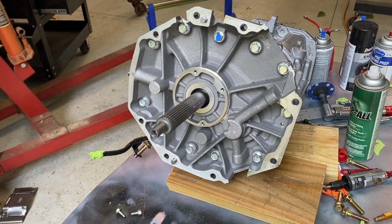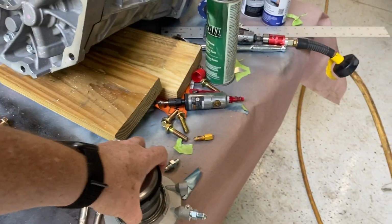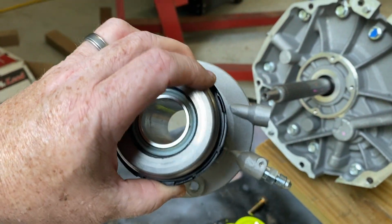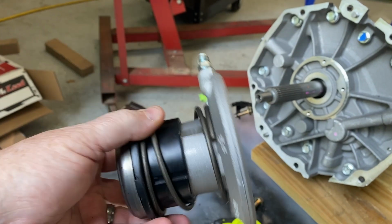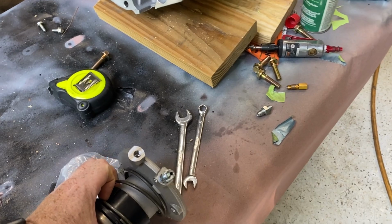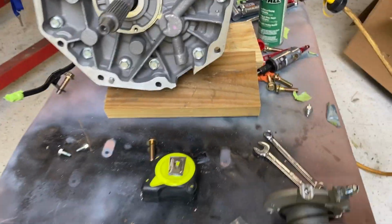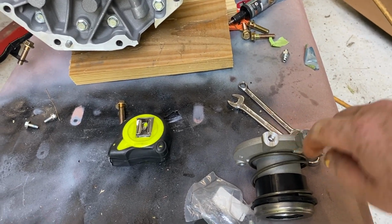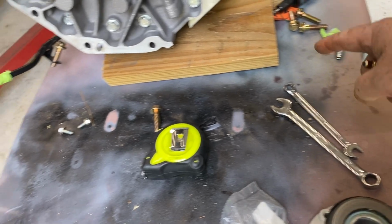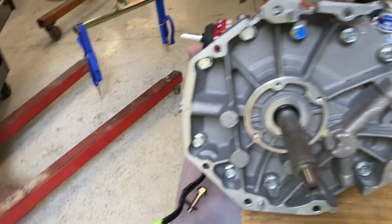All right. Good morning. Prepping up the tranny here. So I bought this just the standard GM style hydraulic throwout bearing. But there's a little issue with it. It came with this big giant bleeder that stuck out like this, so that it almost went out the hole here so that you could bleed it.